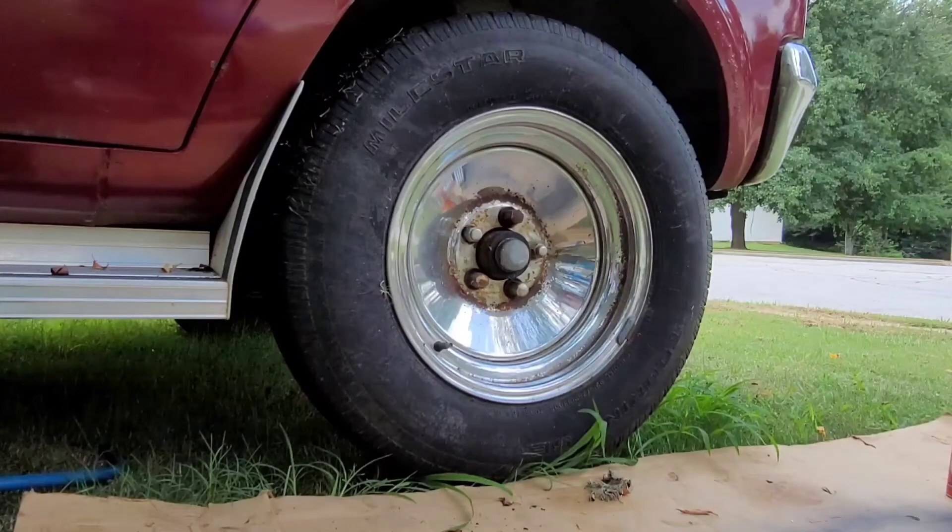The way I do it, I remove the front passenger side wheel to work in from the side. That's the easiest to me, but there are different ways to do it. I already have the jack under the front end with the weight of the wheel off, and now we'll go ahead and remove the lug nuts and get started.